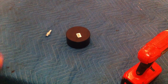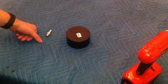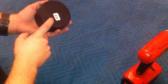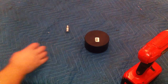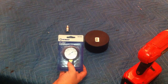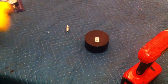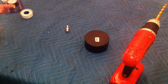I'm going to show you how to make a boost leak detector for a 7.3. It's a lot easier than most people think — it's really ridiculously simple. What you're going to need is a 3-inch PVC pipe cap, an air hose fitting (1/4 inch), and optionally an air pressure gauge. You'll also need a set of drill bits, a drill, and Teflon tape. That's basically it.